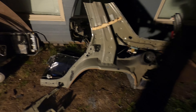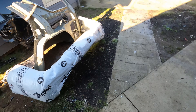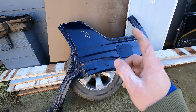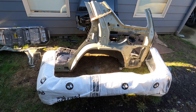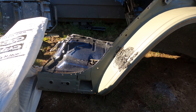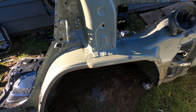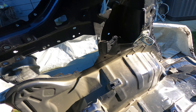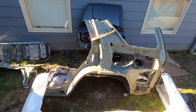Now we have to take the same piece off of this one right here, and we have to take it off nice and neat like we did with the quarter panel. I got a good night's rest and also got the bumper cover in for the 4Runner — this is the last piece I was waiting for. So once we get this piece off, I'll unpackage it, we'll check it out, and we're going to roughly put this wheelhouse on the car as well as the quarter panel. I'll also slap on the bumper and the last two doors remaining just to get a rough placement of all the parts. Once all those parts are roughly on there, we'll be able to start aligning everything. So on this piece I went ahead and started putting little dots where I'm going to do the drilling and little X's where I'm going to be sanding it out. I'm drilling all these and those out, and in the back we're going to sand these three out. That should be it — let's go ahead and start work on this part.